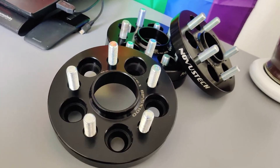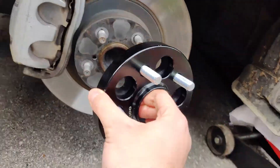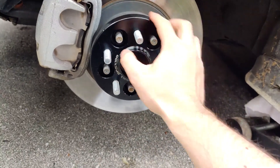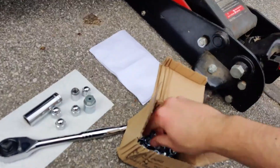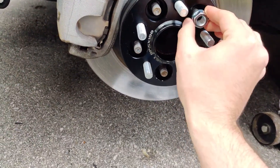I'm going to show a little bit of the prep, and then we'll do a before and after. There's not much science here - we're just going to put this right on. We're going to torque it to spec, the same wheel spec, which on this car is 89 foot-pounds, using a torque wrench and the supplied nuts. These are tapered, so we're going to go taper in.